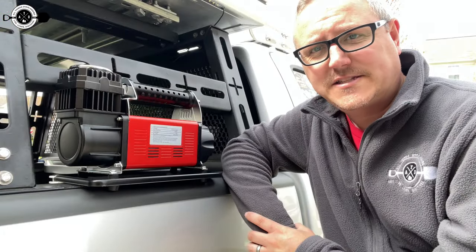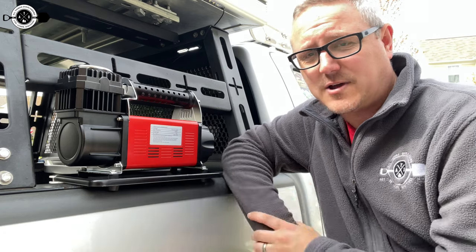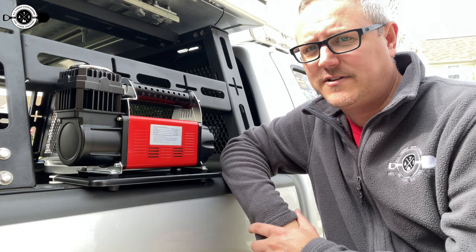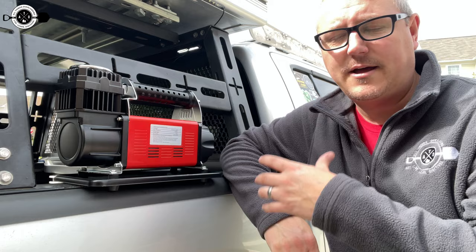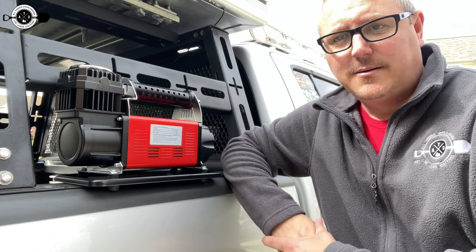That was the Gobeji 5.65 CFM air compressor. For $150 — if this thing works for a couple of years, I'm fine with that, I got my money's worth. Air compressors have kind of scared me away historically. That's why I had a VIAIR 88P — I bought it for 50 or 60 bucks like three years ago and it's been great airing up 31s and 33s. But with the 35s it's just going to take seven or eight minutes per tire to air up. As you saw with this, two and a half minutes — maybe even a little bit less — to get from 15 to 35. So I'm super excited about it. I'm going to try and mount it down in my deck system, hardwired in with a switch and a manifold so I can split it out to all the tires without having to move it around. But it's also nice that it's portable — for the whole time I've been overlanding I've just used my air compressors portably. The hose is pretty long so it's going to give you plenty of room, though you may have to move it from one side of the vehicle to the other to reach all the tires. Overall, super impressed — I think it's a great buy for the value price.